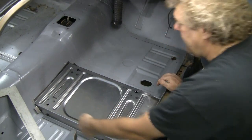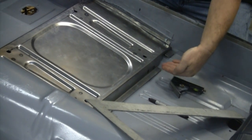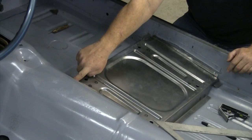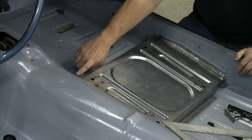The reason I do the holes is this: you could possibly go and measure across the back where this flange is, but I've seen these flanges actually come in a little crooked — it could have taken some damage that pushed this back break over a little bit. I've already got one screw in here. Now that I know I'm sitting where I need to sit, I'm going to put a tap screw right here in the front flange into the floor rather than putting it up in the flange, because I find a lot of times if you put them up into the flange there, the actual flange will walk up and away from you and scoot that pan back. Putting it in through the floor will solidify this pan in the position it needs to be in.